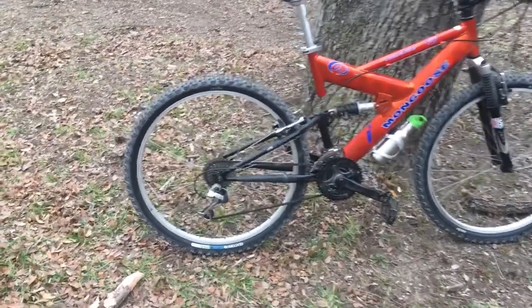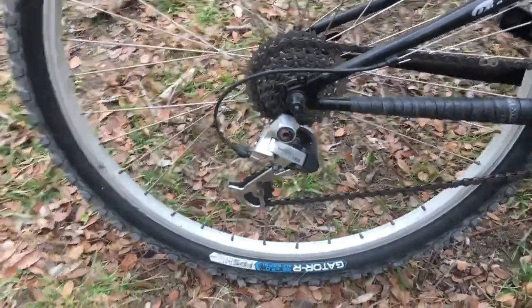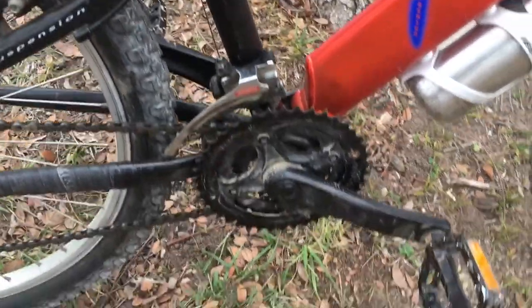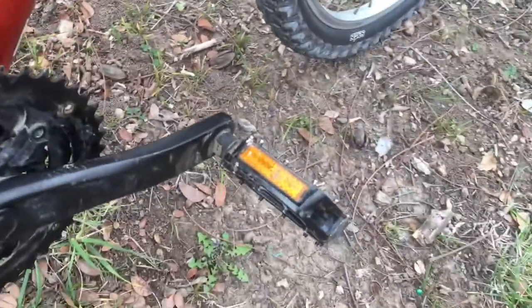So I swapped over this wheel set. It's got a cassette on it, which means I'll be able to change it out or upgrade it if I want to. The derailleur I took off another hardtail that I have — it's a Shimano 8-speed, but it works perfectly here. I just adjusted the limit screws and it shifts amazingly well. The front derailleur is stock; I didn't change that. The crankset is off the Mongoose Deception, so it's a 3-speed alloy, lightweight, with some decent platform pedals.